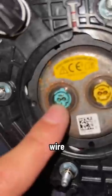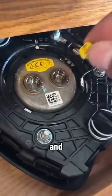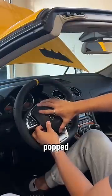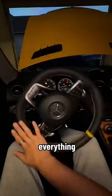However, the car's wire harnesses did not fit in the new airbag, so I ended up having to remove the plastic adapter pins from my airbag and swap them over from the old airbag. From here, I reconnected the wire harnesses, popped the airbag back into place, and reconnected the batteries. Of course, I checked to make sure everything functioned properly, and it did.